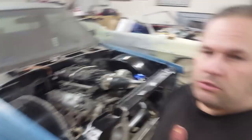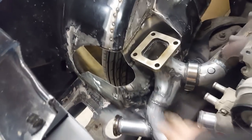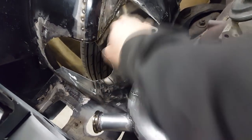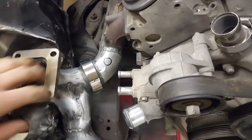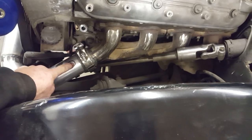It is the next day - or the day after, I don't know. Today I need to finish up a little bit here. With the turbo off you can see how I made all this inner fender stuff - after I put it together it was a little close to the turbo flange. I'm gonna use a hammer and dolly to work this metal a little bit to move it back. Today I'm gonna put the narrowband O2 sensors in - I think I'll put one here pointing up and run the wires this way, same thing on the other side.